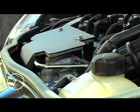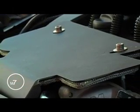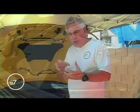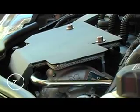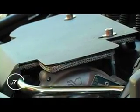The design was deliberately not a blanket wrapped around the turbo, because if you wrap the turbo, when you turn off the car that heat stays inside rather than dissipating normally. It keeps cooking the bearings — and yes, the car has a timer on the water pump to circulate coolant through the bearing passages, but all that trapped heat bakes everything. When the water stops moving, it evaporates, the oil starts to coke, and you get a sludgy black mass that will ultimately wear out your bearings and break the turbo.